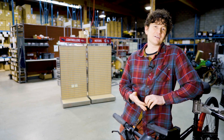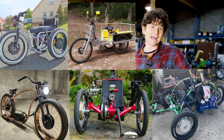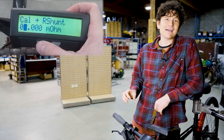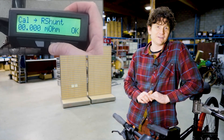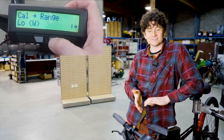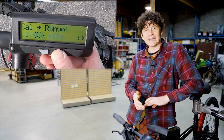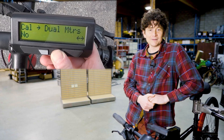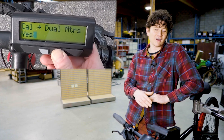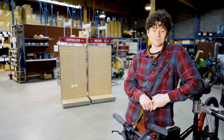There's yet another new feature that's really useful for those of you running dual motor systems. Traditionally you would have to set a shunt resistance to half the value of the individual R shunt of each motor controller, which was convoluted and forced the Cycle Analyst to operate in high range mode showing power in kilowatts. We've now added a new setting called 'dual motors enabled' that automatically doubles the displayed amperage while keeping you in low range mode where power is displayed in watts.